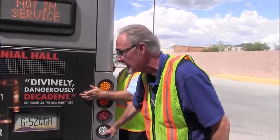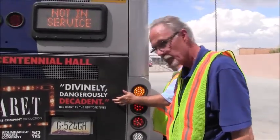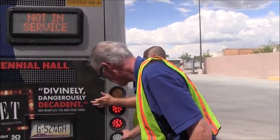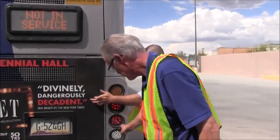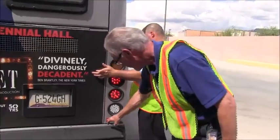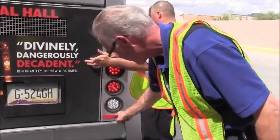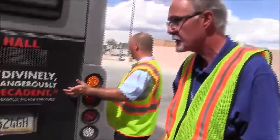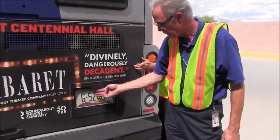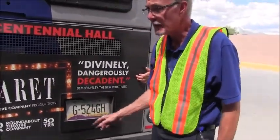This is our backup light. Backup light, while you're in reverse, illuminates the rear of the bus. Proper color is white. No cracks to the lenses. Lens sealed, tight, and secure. We have our reflectors. They're securely mounted and they're not damaged. You'll also inspect that we have our license plate light, the bulb illuminating the license plate.